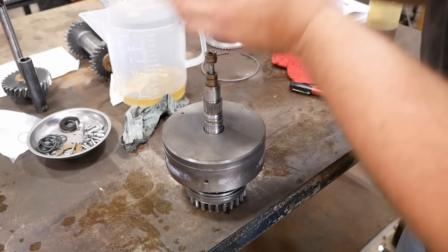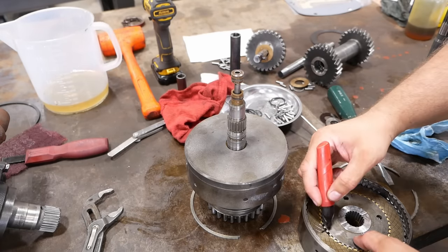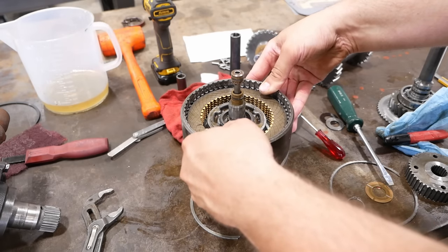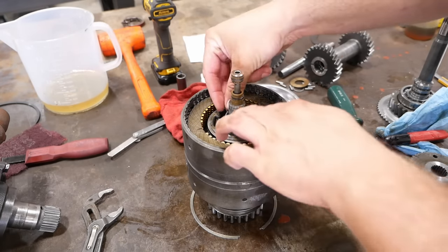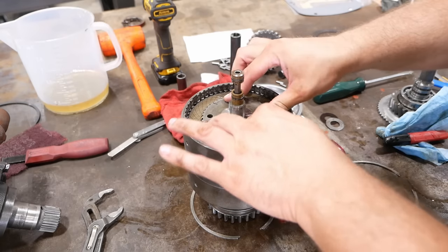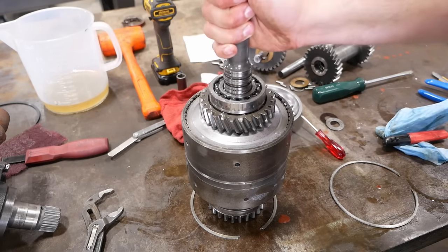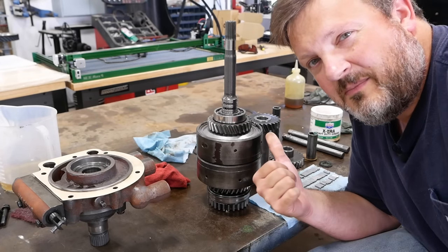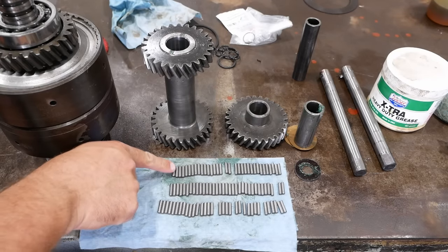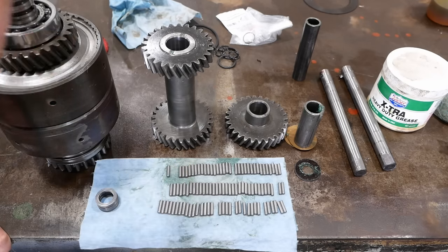I think I need a thrust washer in there — I have failed to read the instructions. I found a snap ring. Now the snap ring. The pump's assembled, clutch packs assembled, but I had a feeling that things were going just a little bit too smoothly. The counter shaft and the reverse idler run on six rows of uncaged plain roller bearings. They have to be tediously assembled one roller at a time — it takes about 20 minutes. I had them all assembled.